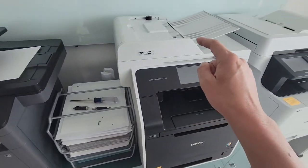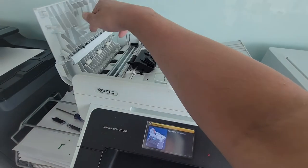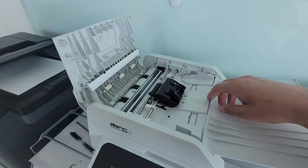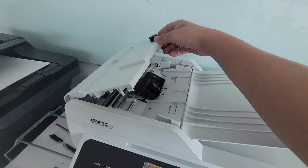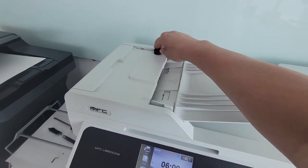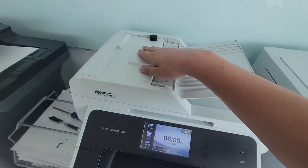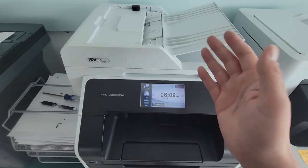Another interesting fix already completed on this printer — I do all kinds of weird fixes on these printers. This lid wasn't closing fully because there's a clip here, and that clip broke off on the opposite end of this lid. So I glued a metal washer here; it's magnetically attracted to a magnet glued on this end of the lid, and the magnetic attraction holds this edge of the lid down. If that doesn't happen, you get an error — the printer yells at you. You can also put some weight up here, but the staff at this office didn't care to keep anything up there. The magnet they're okay with, and everything works fine.